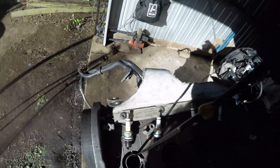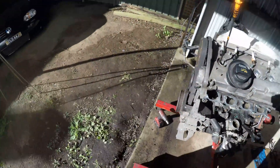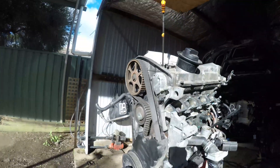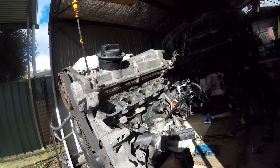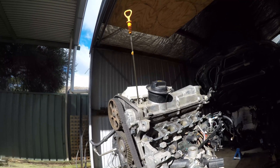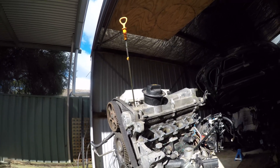Using the old dipstick in cylinder 1, I can watch it rise and fall to determine where top dead center is, and double check where the marks on the timing belt side are. I did have to fine tune the position a little bit, going up and down in little steps at the end. Now the top marks can be easily seen.